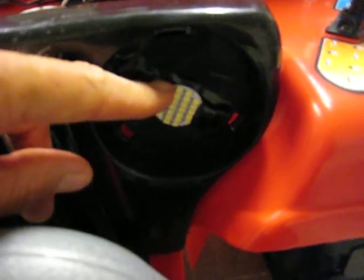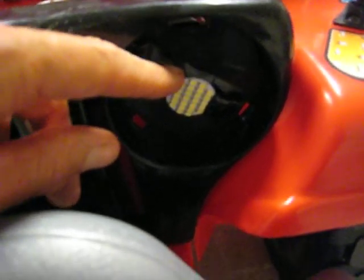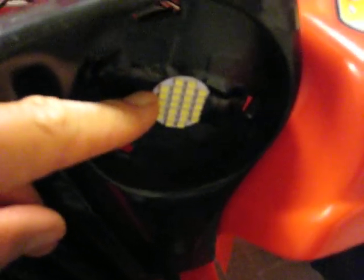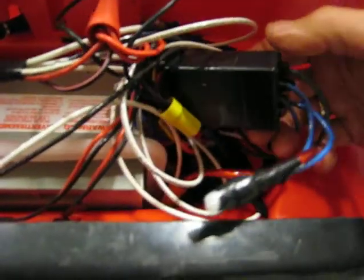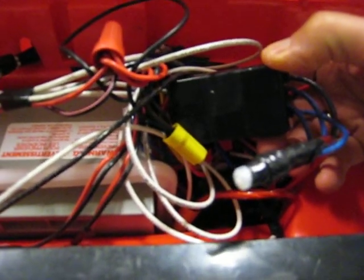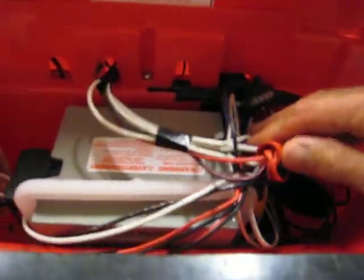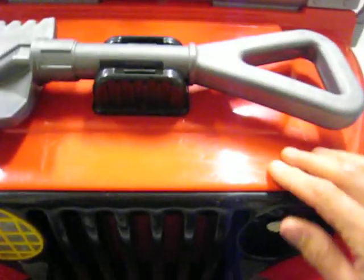I'll just show you what we've got under the hood here. You can affix these micro-LEDs with just about anything — hot glue, rubber cement, electrical tape, which is what I've used here. Pretty lightweight. They're very low energy draw and very low heat, so you don't have to worry about melting the plastic. Inside the hood, you can see this is the remote receiver for the remote kill switch, and we've got a couple of standard automotive relays here, which we've put in for the lighting and the ignition switch, which minimizes the amount of current flow into the dashboard.